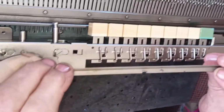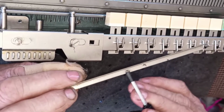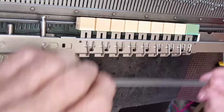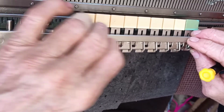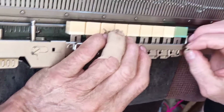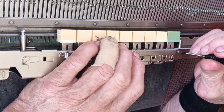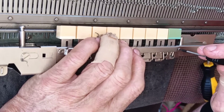All right, now we're going to put the retainer bracket on, and here are the features. A stop tang right there. It's a 90-degree top face over the rail, and the tang that I showed you is your spacer. So we line it up, we get our teeny tiny little screws, and as usual, start everything before you tighten anything. Once this is tightened down, our clips aren't going to run amok anymore.